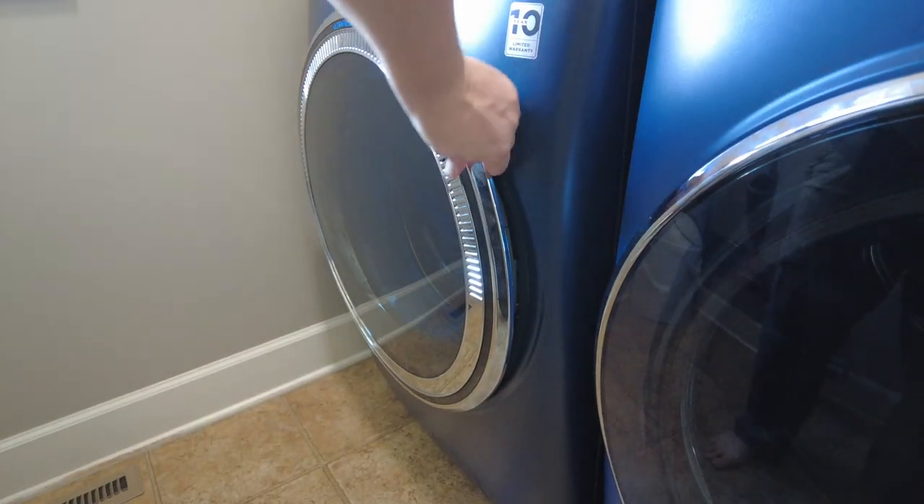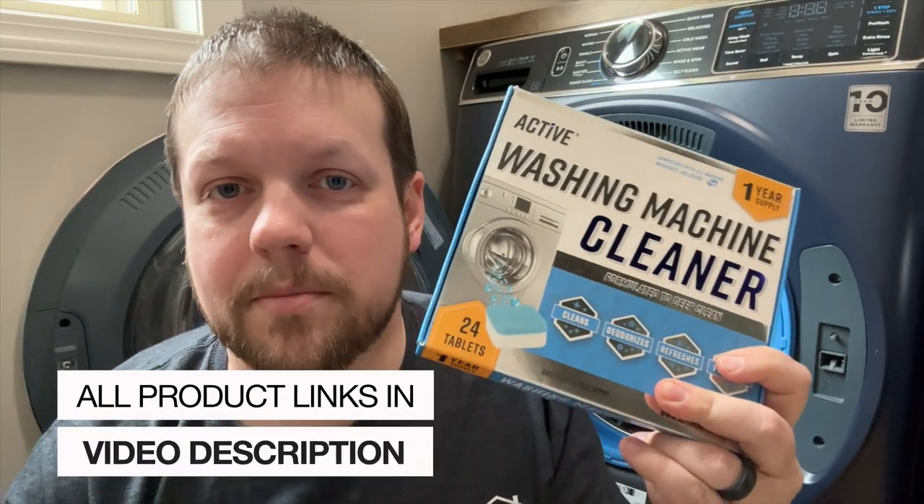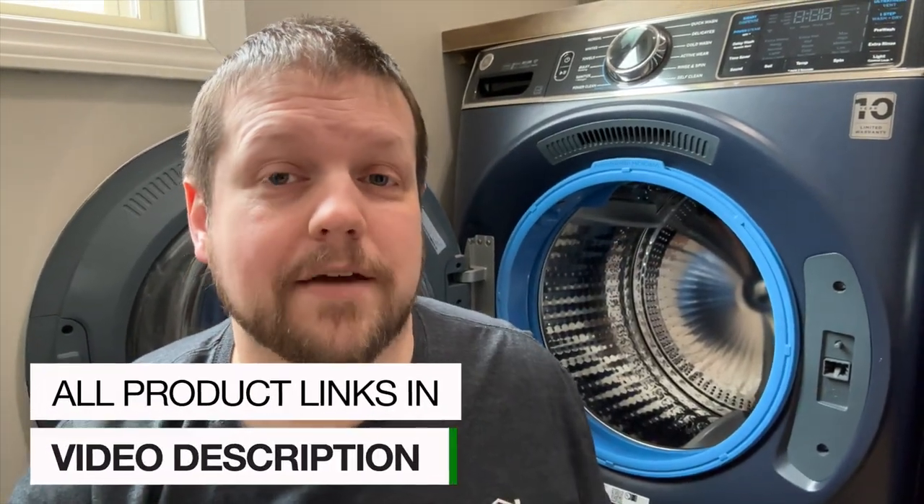It's also a good idea to keep the door open slightly at all times to allow it to dry out completely and prevent mold and mildew from growing. I've seen this time and time again on front-load machines — it causes a lot of issues and can be prevented by simply keeping the door propped open just a little bit to help get airflow going. If you have a top-loading washing machine, the fabric softener dispenser and the agitator should be cleaned every month or so to clear out any residue. To give your washer a deep clean, run an empty cycle with a mix of vinegar and baking soda, or you can use a specialty cleaner — this will help eliminate any leftover odors and keep your machine working efficiently.